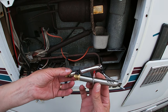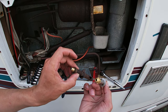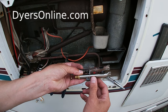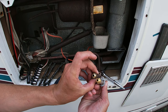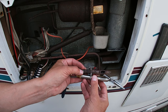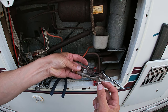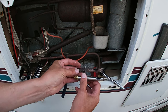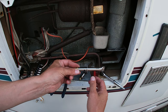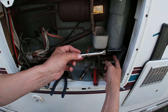This is all just Norcold parts, so you can literally buy these right off the serial number of your fridge — very easy parts to get. I found mine at an actual fridge repair company that sells parts. It's an exact fit, and that matters. Other fridge components might fit on the fuel nipple, but you need one that has the right orifice for the propane, the right oxygenation, and the tube exit at the diffuser in exactly the right spot to go directly up the heat tube. This mounting pinch fits through a specific slot in the steel on the other side. Do not get the wrong tube — the size of fuel and the diffuser all need to be matched to the space where your fuel heat needs to go. Don't mix and match.